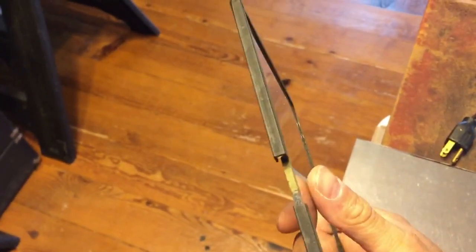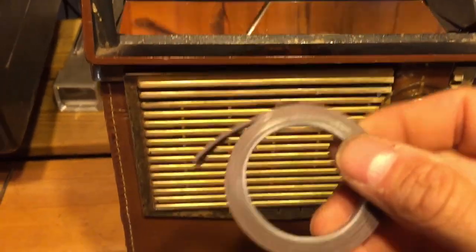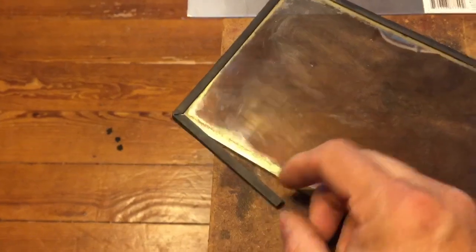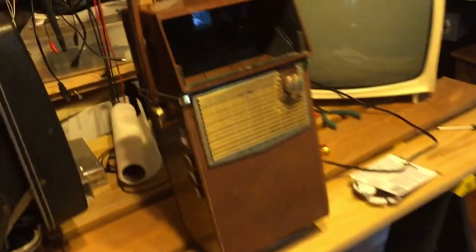Notice the thickness of the original is probably four or five millimeters — see how thick it is — while this acrylic material is just a fraction of that thickness. There's a retainer bar on the bottom and on the top, and I used some double-sided foam tape to pad the bar to keep it from rattling. I put some on the bottom bar and some on the top bar, and when I screw that back in, it gently holds the piece of acrylic in place, replacing the need for the original rubber gasket.